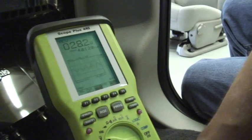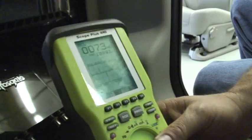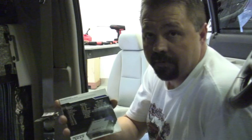We've done the front channels; now we'll do the same to the rears and then we'll do the same on the sub-amp. On the sub-amp we're going to have to use a different track because it's crossed over and it's playing the sub-frequencies. Luckily we have three different frequencies recorded on this, so we'll use 40 hertz on the sub-amp.